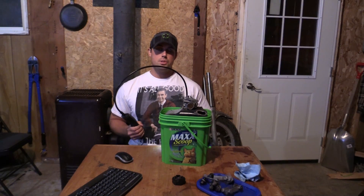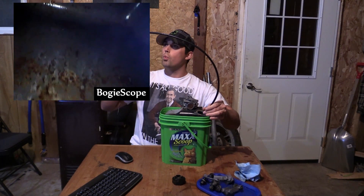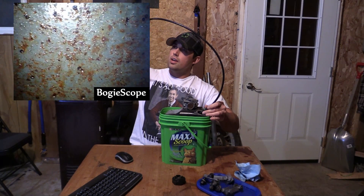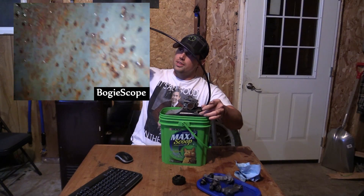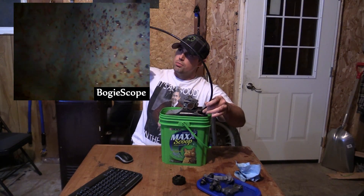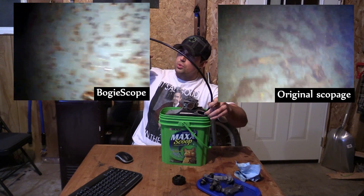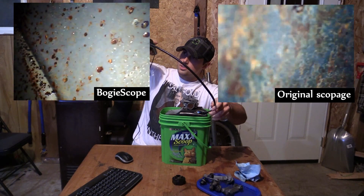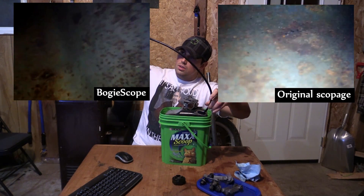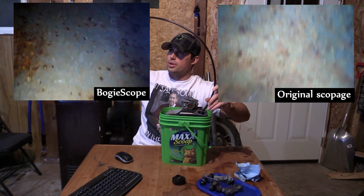It's been just over 36 hours. I got a little busy doing stuff, couldn't check it last night. Time to make an assessment. I'm a bit disappointed. This was an exceptionally bad fuel tank — very, very pitted. All the spots with the little dots of rust are all pinholes waiting to happen. This fuel tank was not stored properly at all. There are some spots that look better, but yeah, look at all those little divots and dents and rust that just aren't going away. I probably needed something a little bit stronger for this project.